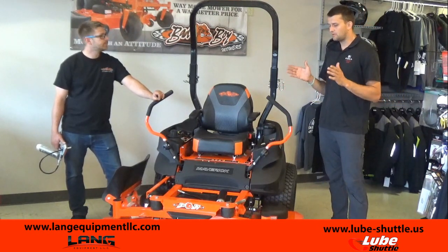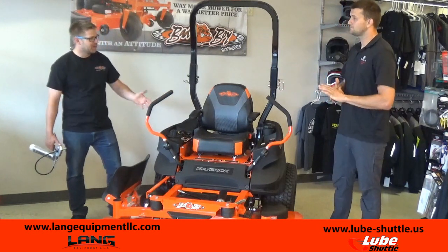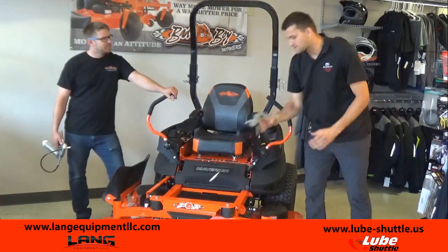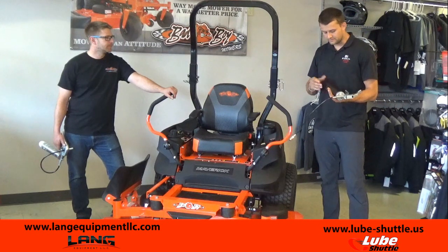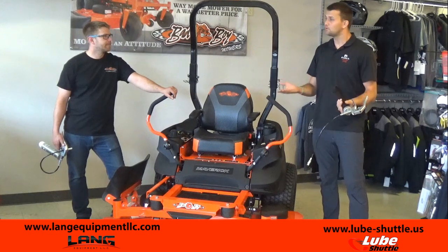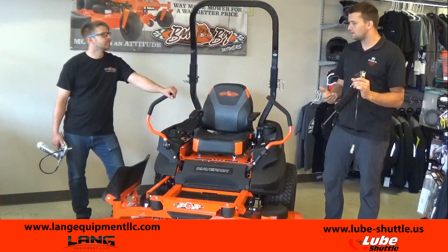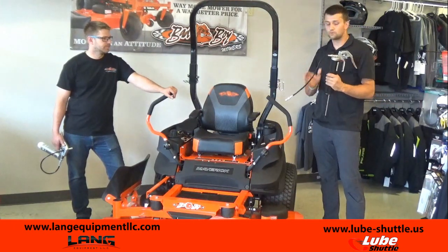Easy to find. Now, greasing can be a little bit of a headache, and it can be messy. There are products out there that are lifesavers in that area. They clean it up. Now, this is the grease gun I was familiar with. I grew up on a farm, and this is the culprit right here. Usually you start by getting yourself full of grease before you even start. Now on this model, I think most people are going to be familiar with this. You pull back on that spring and plunger here, and then you can unscrew it, put a new tube in. Usually some grease leaks out of the back. Now these are notorious for leaking grease out on your floor and getting air gaps.